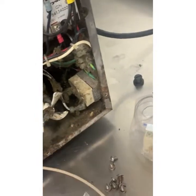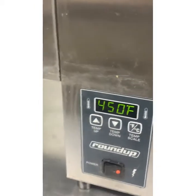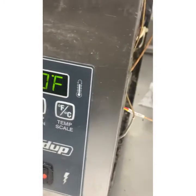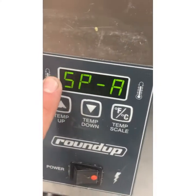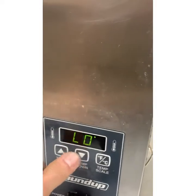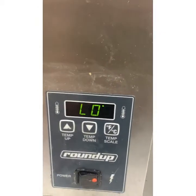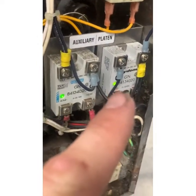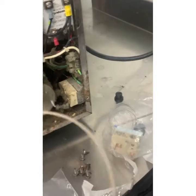With the new probe plugged in and everything firing up, it's not the board. Here's the new one hooked up. Let's turn it on and let it run its boot-up. It will say 'low' until the air temperature reaches above 260-something degrees — but notice it no longer says 'high.' Now we have the plate relay active — 100% bad probe confirmed.